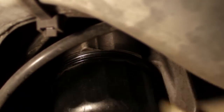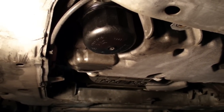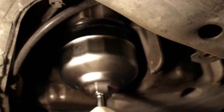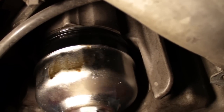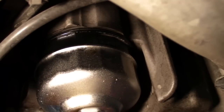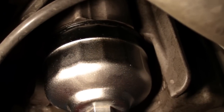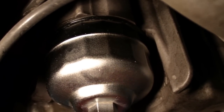Once we're about hand tight, go ahead and grab the ratchet and the tool — same as before, but now we're putting it on. Seat it on there and it does not take a whole lot of effort; it's very important to go slow here because if you go too fast, that seal might pinch. Just get it on there and notice where it catches. Be careful not to over-tighten it — if you over-tighten it, you're likely to break it. Notice where it kind of stops; from there, just give it a little more oomph and that's really it.